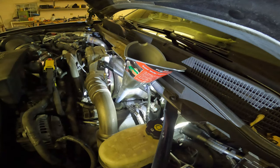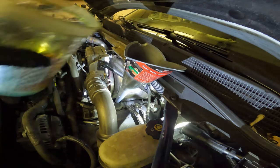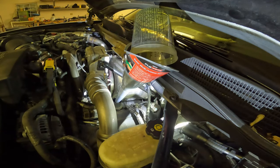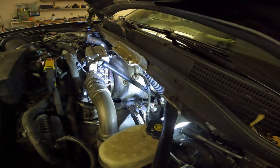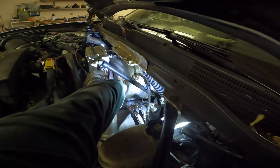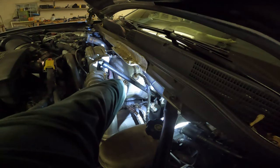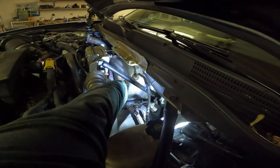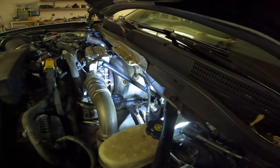This is the last little bit of oil from those other 2 gallons that I was letting drain into this cup. So I'll just tip that in there and let that drain. Shut you guys off. All right, so we have drained the oil, changed the filter, refilled it up with oil. We're gonna put this cap back on. You'll feel it kind of set down, and then it'll screw on the rest of the way. There it goes. And it just goes so far, so that's all done.